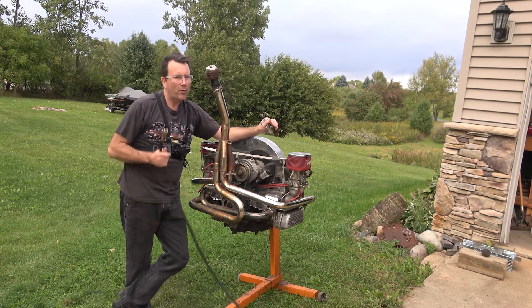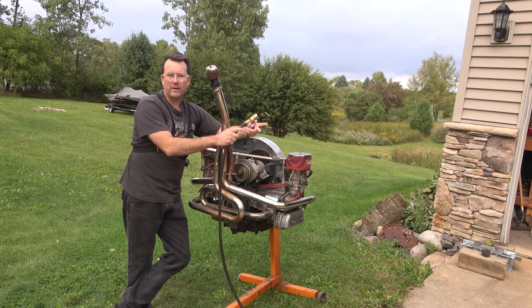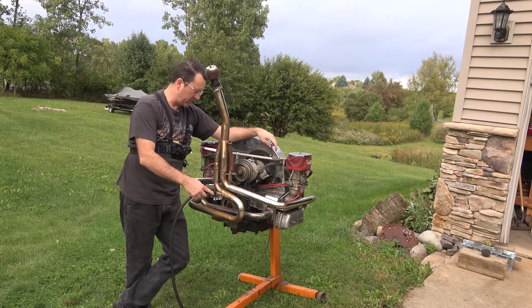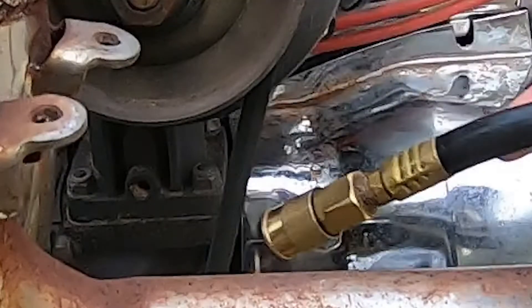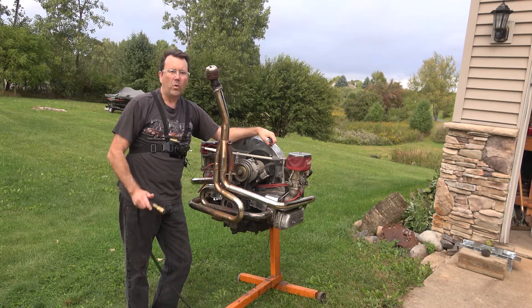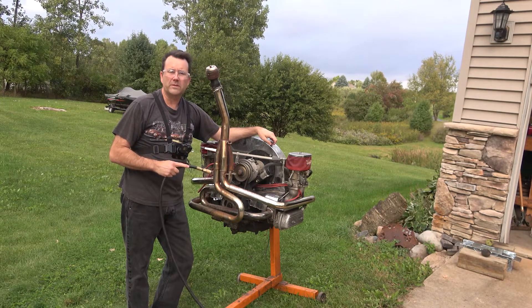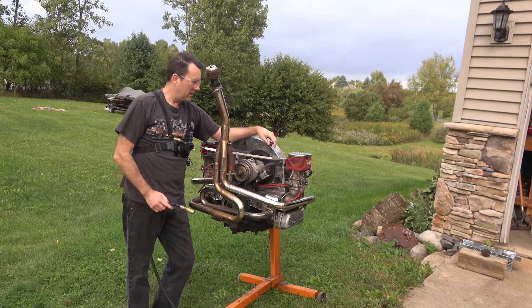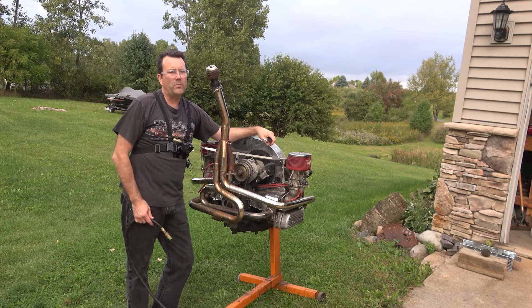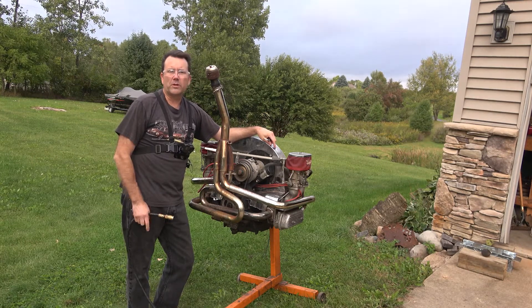As I'm finishing up, I've realized I haven't told you guys the specs on this engine. I'm going by memory because I lost my book — I used to write down all the specs every time I built an engine: piston weight, rod weight, deck height, compression ratio, CC'd heads, and always the serial number. I lost it — I had about 20 to 25 engines in that book. I'm pretty sure Brian's was a 2276 — some people call it a 2275 cc engine. That's an 82 millimeter crank with 94 millimeter pistons. He remembers I told him to run a mix between racing fuel and 91 octane, which would be about 105 octane, meaning it probably has compression up to roughly 10 to 1.